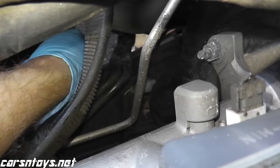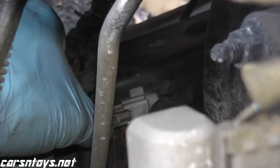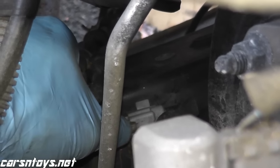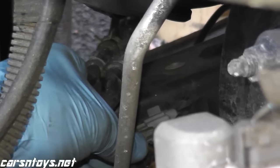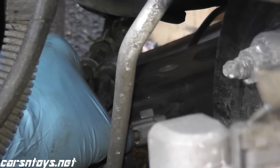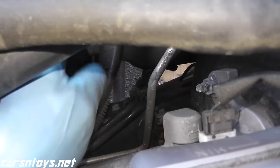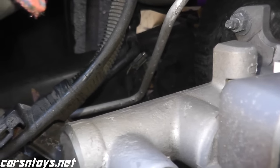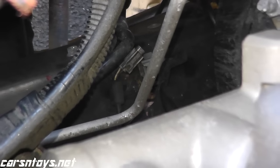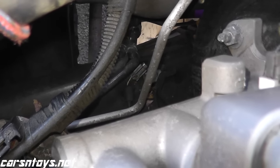I had to do this off camera, but right down there — let me zoom in — this is where the connector lives. I had to press down with my thumb. It's a little hard, I'm not going to lie, but it took maybe a good minute or two just to get a good grip on it and press down with my thumb. If you have a very long flathead screwdriver, you can also try that, but be incredibly gentle because you don't want to crack the plastic body on the sensor. If you can, do it with your hands, because that's going to ensure that nothing breaks.